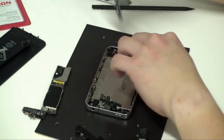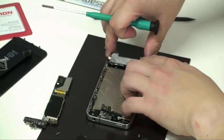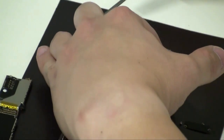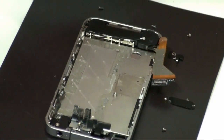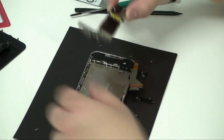Proceed to place the speaker box. Keep in mind all four prongs must be present when you place it in — wedge it prongs-first against the chassis so all four are contacting the chassis tightly. If some of them break, you will experience a loss in cellular reception. Next, make sure all your cables are away from where the board used to sit, as we're going to be placing it back in. You might see a rubber bit fall off — you don't need that, but it's good to have as it protects the LCD and digitizer flex cables.